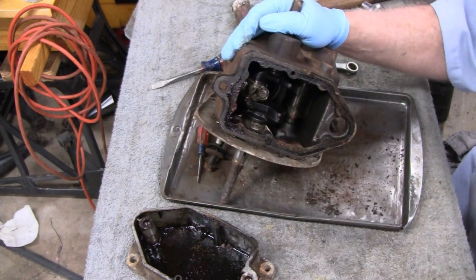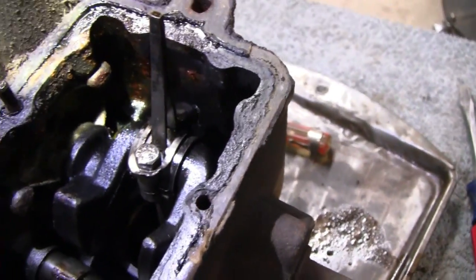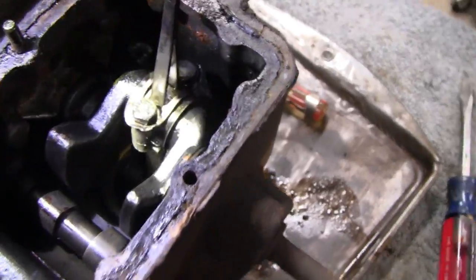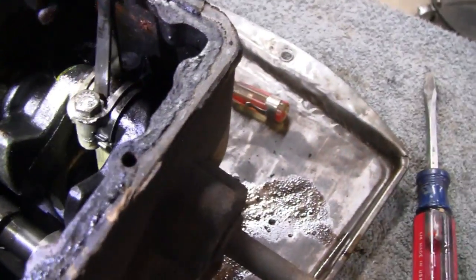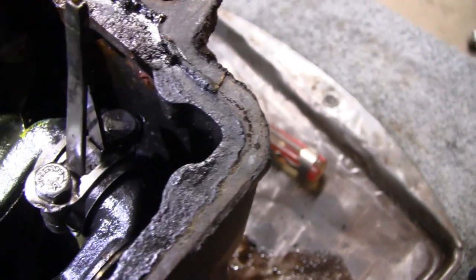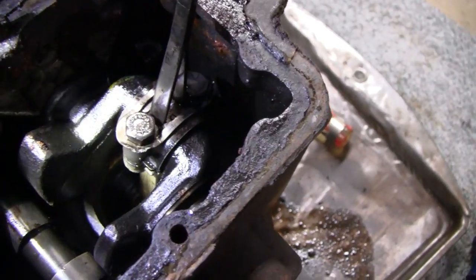Let me look it over and then we'll zoom in a little bit. Things in here don't look bad at all — I was expecting to see a lot of rust but there's really no rust at all. So it might be the piston holding it, or it could be the crankshaft here and the bearings. I'm gonna take that slinger off and disconnect the connecting rod. Getting to that bolt in the back might be tough since the crank isn't rotating, but I'll see what I can do.